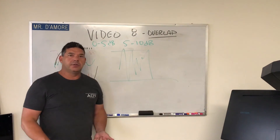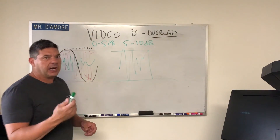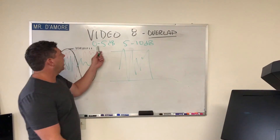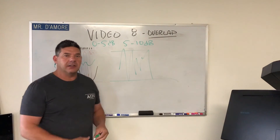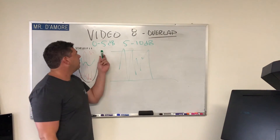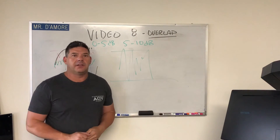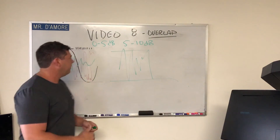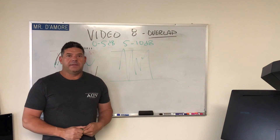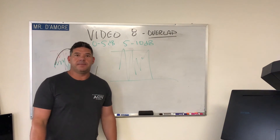If you're using our tool, the DD-1, you can select 0, 5, or 10 dB overlap with the CD or tracks that are included. If you have a DD-1 Plus, you can set it anywhere in between in tenth of a dB increments — that's really handy. On my personal system, I do about three here and about seven or eight over here, and it works great for almost any type of music. Hope this helps. If there are still questions, leave them here and I'll do my best to answer them. Thanks for watching.